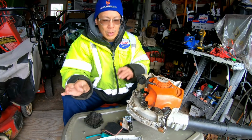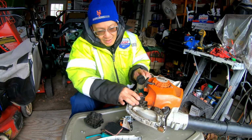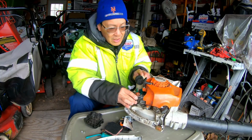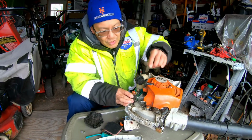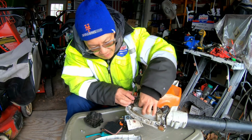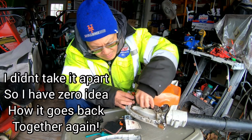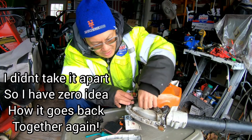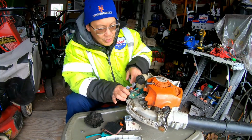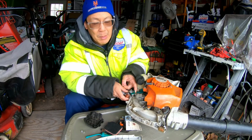Oh, it's about to fall into the insides. As you can see, it did come with the linkage, comes off the two studs there. I'm gonna make sure how the linkage goes here, because if you get the linkage wrong, it'll drive you insane. I'm just gonna keep it like that. Don't move. As you can see, it comes with that one-piece molded fuel line that's been busted.